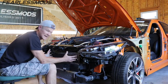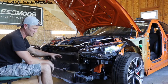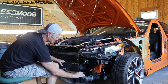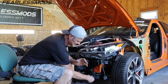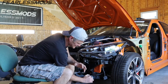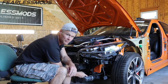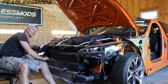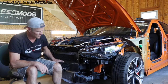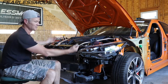We got the air dam out and the two inlets right here — just a bunch of 10mm bolts and undo some wires. Now we're taking off the top mounts for the intercooler. While I have something to press against, I'm going to go ahead and get these tubes disconnected. I'll get a screwdriver in here and pull back this retainer clip and allow myself to pull these tubes off of both sides. This side has a clamp. And then we'll be ready to unbolt the intercooler and pull it out.